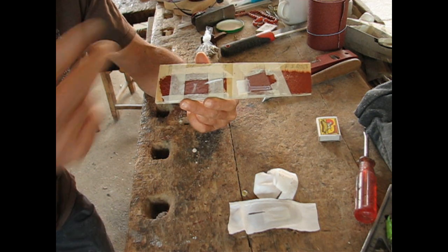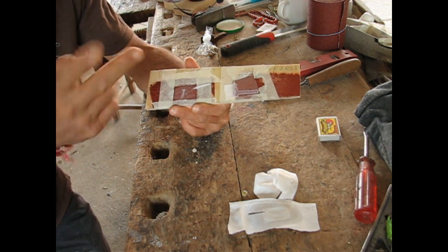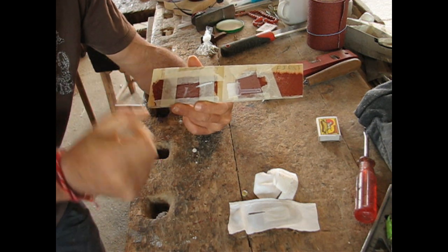It doesn't matter if the primer comes above the epoxy or the epoxy comes above the primer. As long as they're still wet, they will bond. But please understand, this test is highly successful and it's worked very well for me with the materials that I have used. So go ahead, do it. You can eliminate the sanding of the fiberglass. Yeah, you can fill the weave. That's what I'm gonna do.